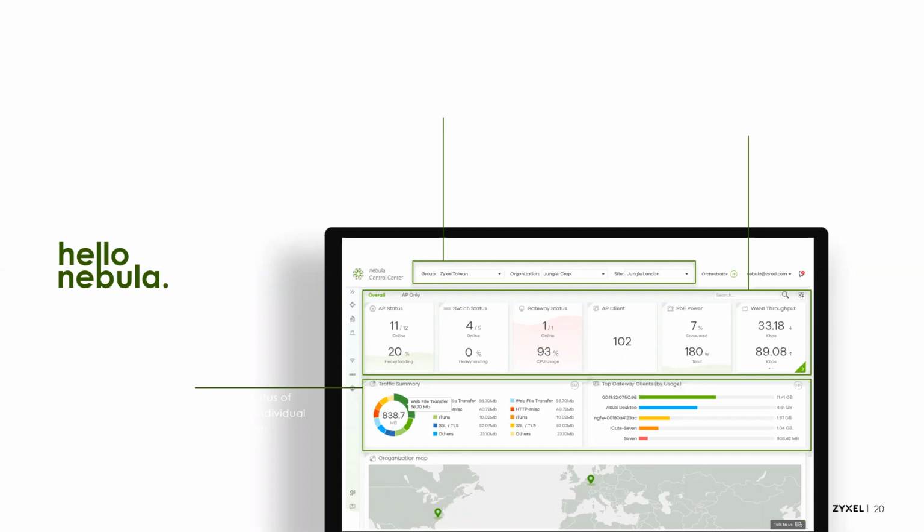The widgets there on the screen, a lot of that can be customized as to what information is there, but it gives you a snapshot of everything up. You know, how many wireless devices are connected, your PoE usage versus the PoE power budget, bandwidth utilization out through your WAN. If you're using our NSG gateways, you can see not only how much bandwidth is being used, but what specific apps and which specific users are using that bandwidth.